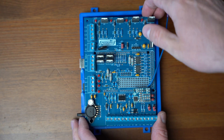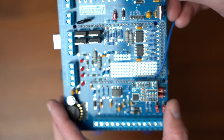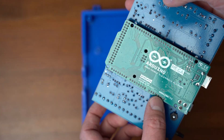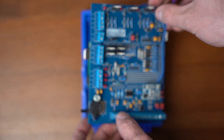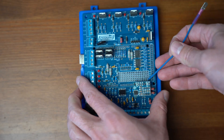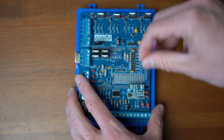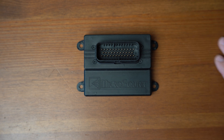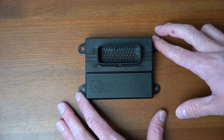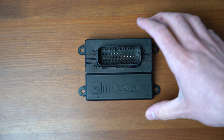Taking a closer look at the Speeduino, you'll see there is a prototype area that gives you additional inputs and outputs for communicating with the Arduino on the backside. Basically, if you want to run launch control — this wire right here is actually the input for launch control — you have to go in and solder in a pin and a wire to run that individually. Whereas with the Micro Squirt, there is a dedicated pin and you can just select which one you want to use in software.